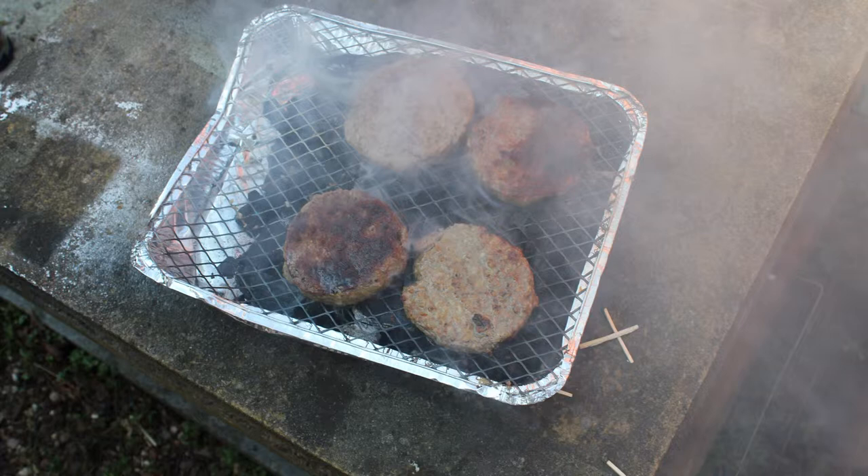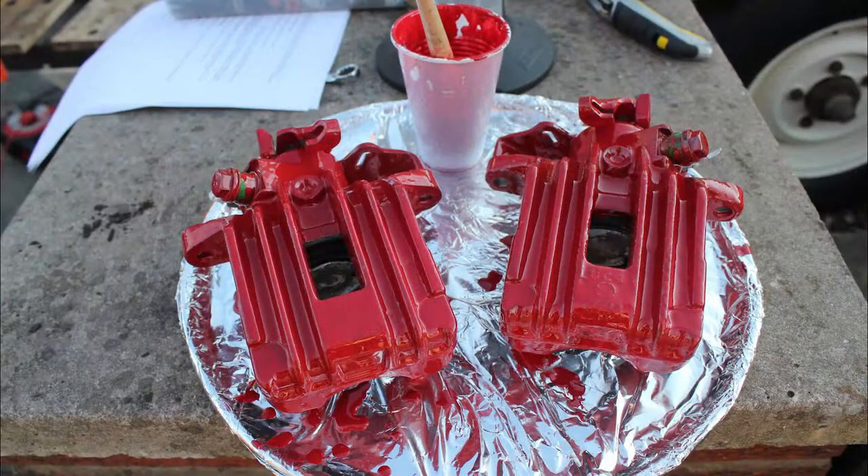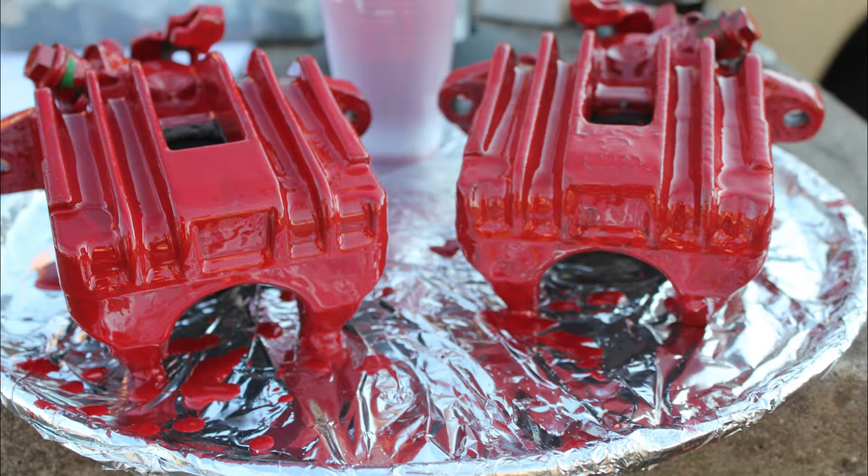Something like this does take a fair amount of time. Once you've cleaned everything back you can see how the carriers and calipers look — compare that to the very beginning of the first video and it's quite a difference. This is after painting them with some high-temperature paint and after a few layers they go into the oven to bake the paint on.